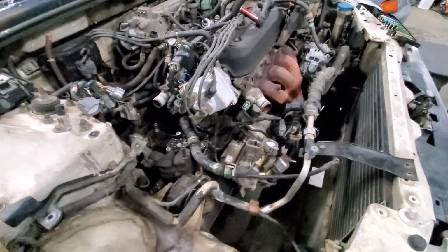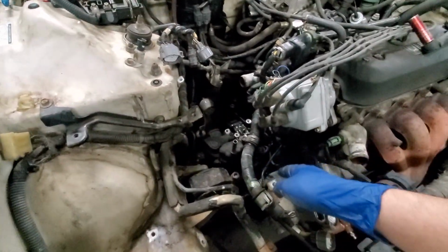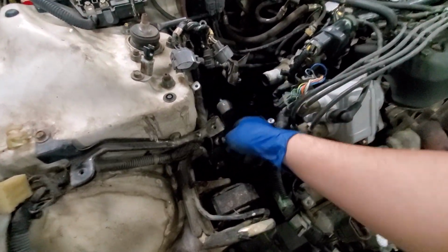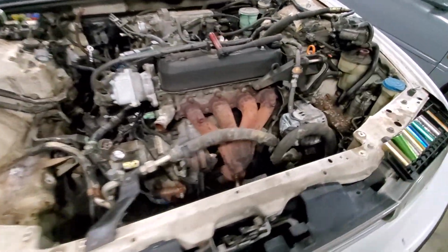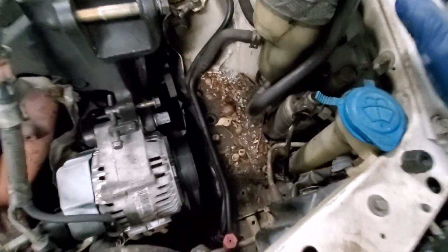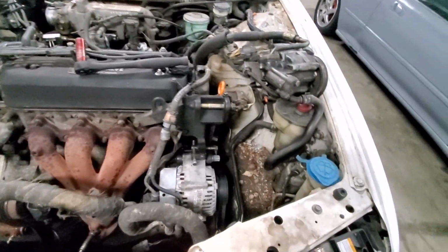So yeah, anyway, I got the clutch line unhooked from the top of the trans here, and got the shift linkage disconnected and got the actual bracket, took off the trans. Everything is looking beautiful. But I just really want to make sure I video all of this stuff, man. Like, look at how disgusting this thing is. I mean, it has so many acorns. It's almost like a squirrel was living in this engine bay.